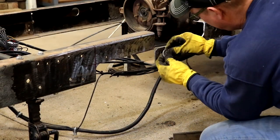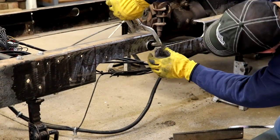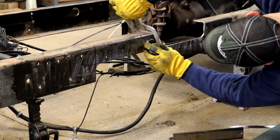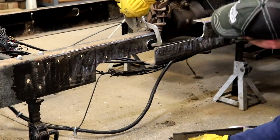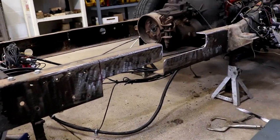This is what I used the plugs for that I took out of the hole saw. It just makes it easier to mark, and you know you're going to get the measurement exactly right. So when you pull them together, they match perfectly. You've got to get this frame welded square or you are going to have one big mess.